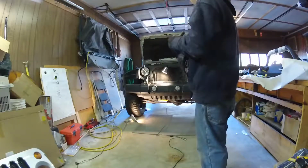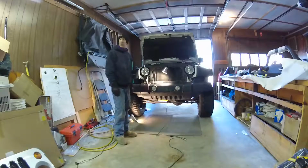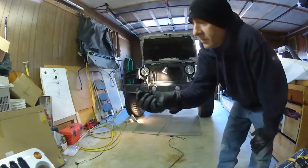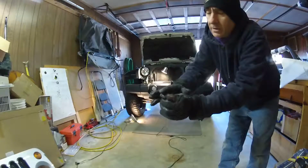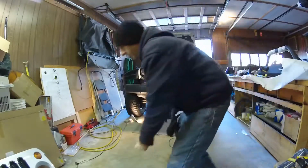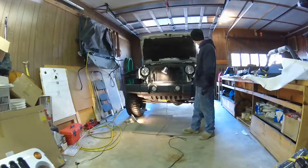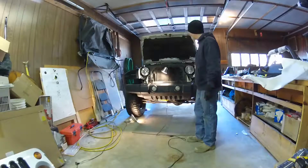Hello everyone, we have the front grille removed, which is part of the process I've got going on today, because besides the front bumper install, I'm also changing out my headlights. So we pulled the front grille off, pretty simple situation here. We've got these little clips. This is the way they'll be seated in your grille. What you do is you pop this centerpiece up like that, and then this comes right out. That's a two piece. You see, we're taking the fog lights out, putting in the new bumper, removing the headlights, replacing those with the new LED headlights, and then we're putting everything back together. And you'll be seeing video all along the way. You'll see how it goes, and you'll see more, maybe you'll see less.